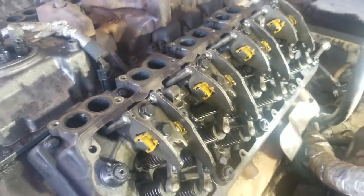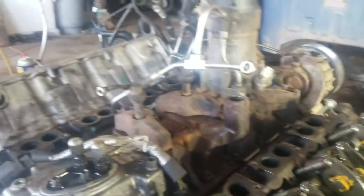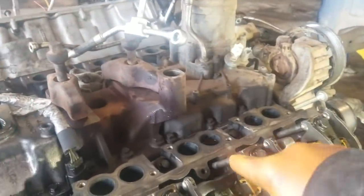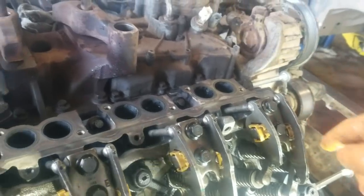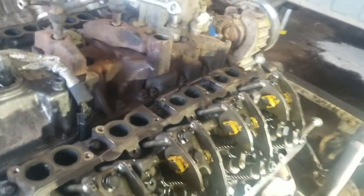What you want to do is, when you have that valve cover off over there, rotate the thing till you see cam lift on either number 3 or number 8 on the intake valve. These are real easy to figure out. There's I for intake, E for exhaust. So when you're rotating around and you see that thing starting to come up, look at your dowel pin on your crank and get it pretty close to the 10:30 position. And it was really easy to do with the head off on this side because I had the piston at the top, and I had valve lift on number three, and I knew it was at number one top dead center. So anyways, that's where I wound up on the other side.